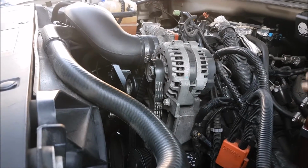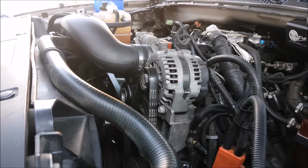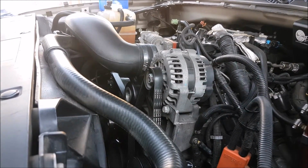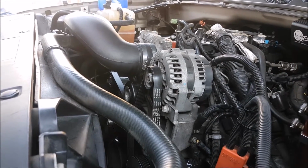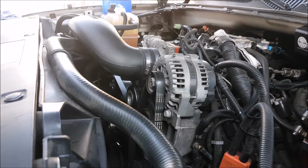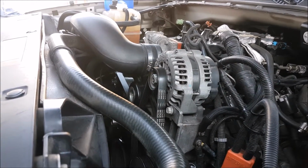Some of you that are watching this video might realize that I did not do a flush. The reason why is about a month ago we actually changed out the rad fluid, so I didn't see it necessary to flush the whole system, so we actually left a bunch of it in there that was in the heater core and everything, and we were just topping off our level. So if you are looking for a coolant flush video, you'll have to search in the description below.